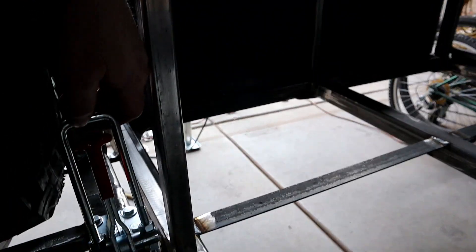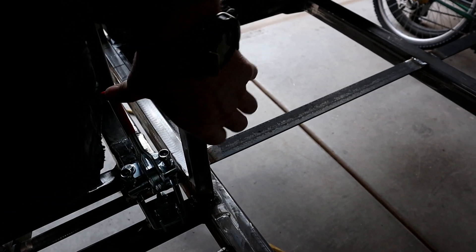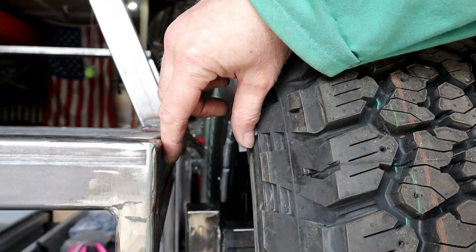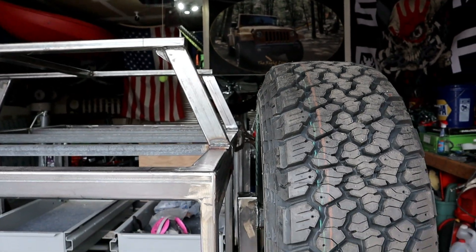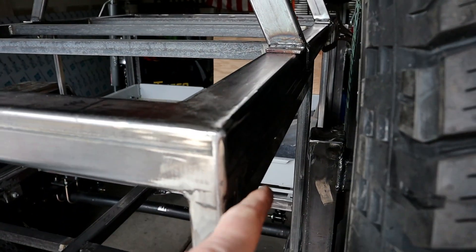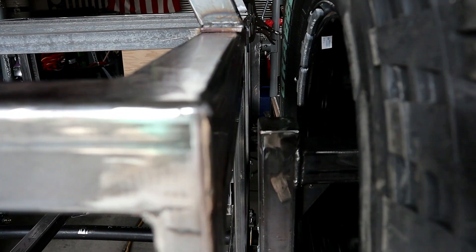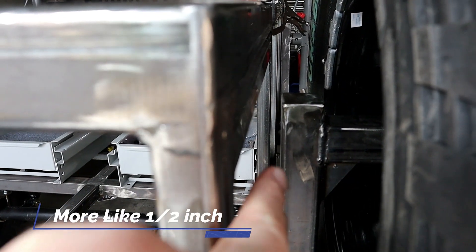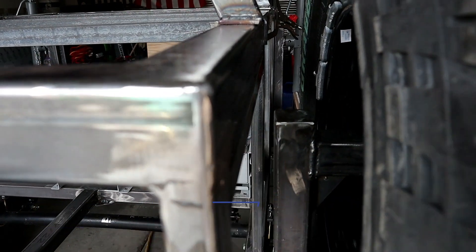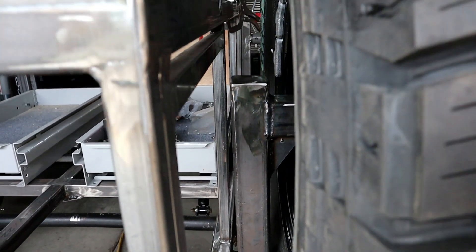There's the stop right there. I like a polyurethane bushing, and it keeps this from bouncing. The only modification I think I might have to do — and I tested this just a minute ago — is the gap between the wall and that upright of the tire carrier. With the RV door in here, there's about 3/8ths of an inch difference between the surface of the RV door and that right there. So I may have to notch this down and tip this out just a little bit to clear that door.